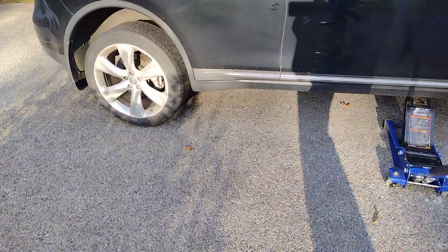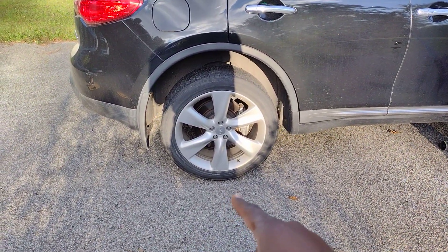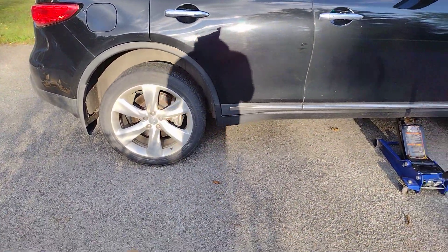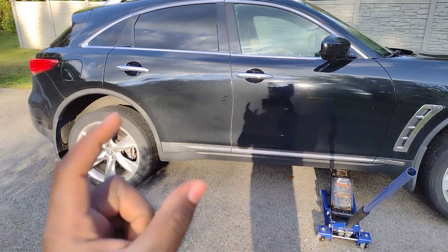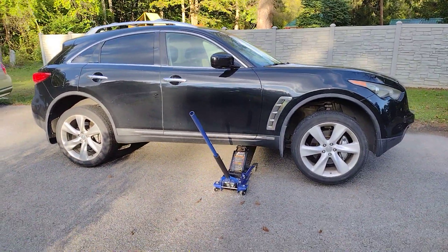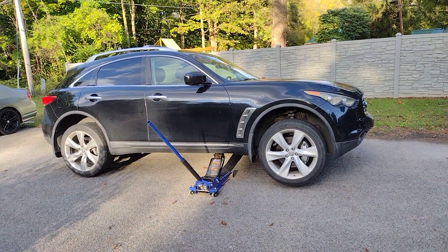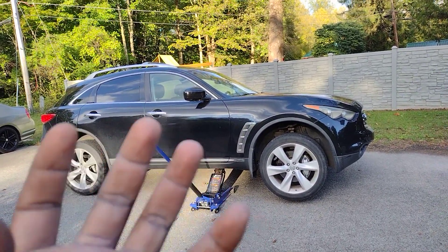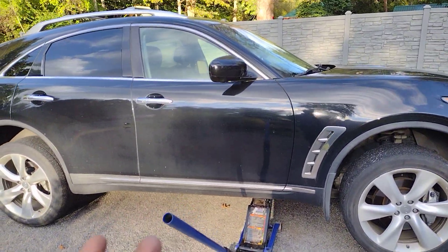My only holding point is the one in the rear. It's just something you need to be cognizant of — do not jack your car up on an incline, downhill, or going forwards because things could happen unpredictably. Your scissor jack, as much as it gives you an emergency option, it's not for regular work, because depending on how you've loaded the car you could lift it high enough and then it starts moving. Sometimes you can raise it so high that even if you put a wheel chock over there you end up running it over — I've done that in a controlled test and sure enough it just tipped over and wasn't holding it.